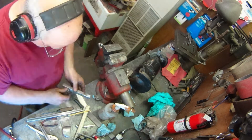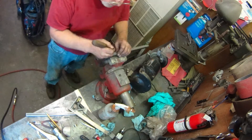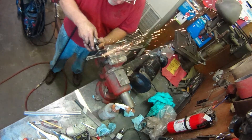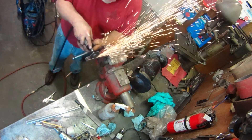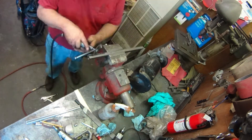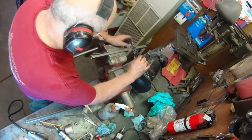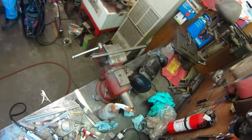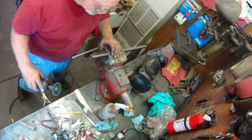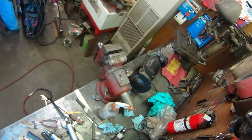Here I am fitting the lower portion of the reinforcement. I had to make it a little thinner — I wanted the tube to be square in the joint between the pinch weld and the firewall, but the torque box sits a little more proud of that, so I had to cut a small portion away in order to get it to lay in there perfectly and not distort the metal when I clamped and welded it in.